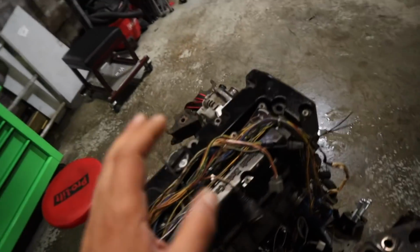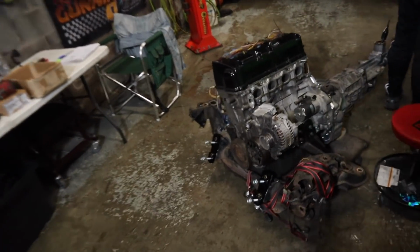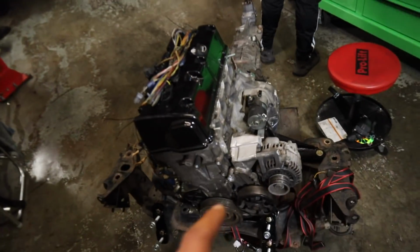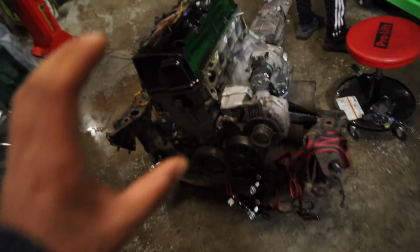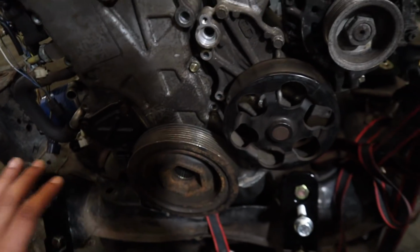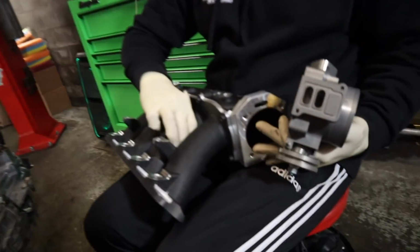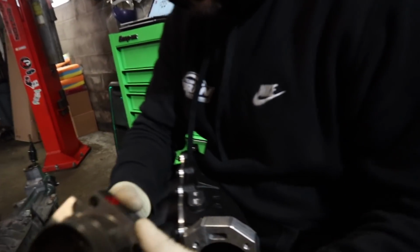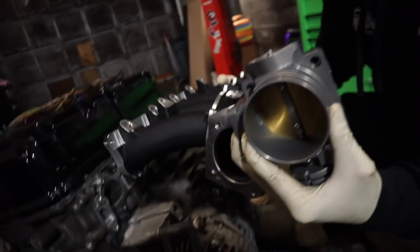So we're waiting for an intake manifold. Gunners are sending a K24 A2 water pump housing. We'll be able to run the EP3 tensioner, right, Trap? And idler pulley on top right here. And then we'll have all of this together nice and clean, nice and neat. And we'll be done when we get our K Miata intake manifold, Trap. Yeah, theirs is going to sit like that. Yep, which is going to be nice when it's on there.